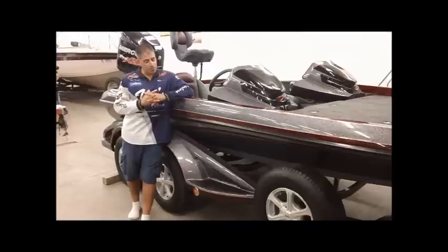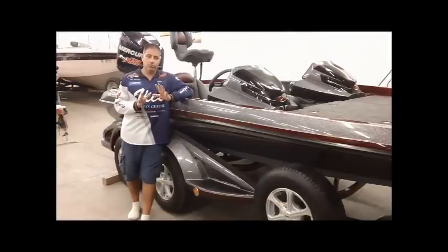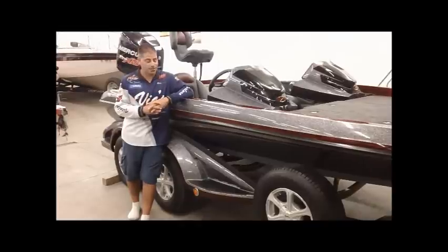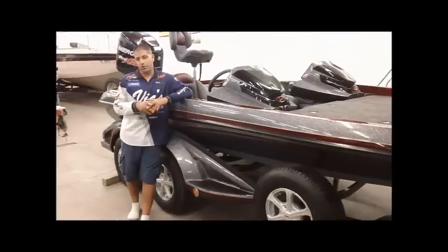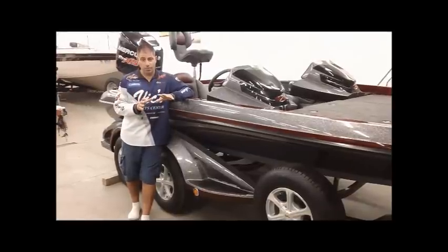The main thing with a Ranger Trail trailer is that they do not use a tube trailer underneath, okay? Ranger does build their own trailers at the plant, right there. They have their own trailer plant, which is unique. Ranger's, I believe, the only company that does that. But they are all C-channel, okay? And so no water holds in the frame of that trailer. They also have gone a step further now. They actually have road armor on their trailers, which is a spray-on bed liner that is extremely durable, stopping any rock chips or anything like that on your trailer.